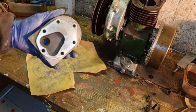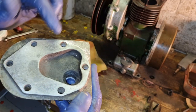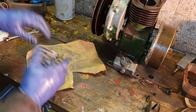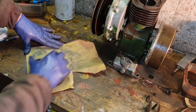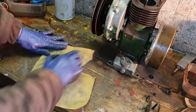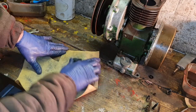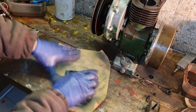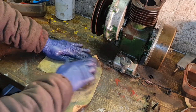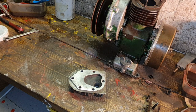You'll know if you've got any high or low spots in this aluminium head. It's a little bit dark there, see that? Only a smidgen. That just shows that that head is a little bit low in there. And surprise, surprise, that's where the exhaust valve is, where that head has got the hottest. So keep doing your rubbing on your bit of sandpaper. There we go. That is now all evenly shiny. So if there was any distortion in that head, we have taken it out.